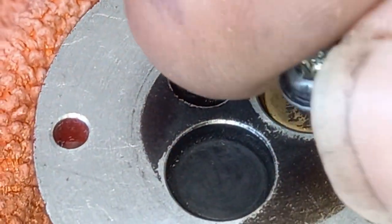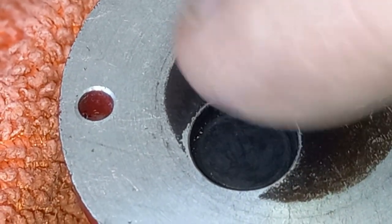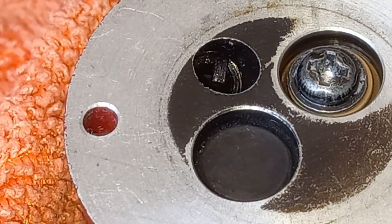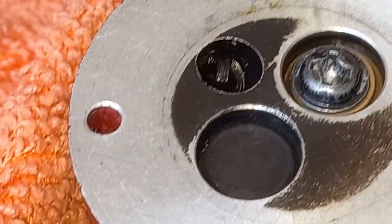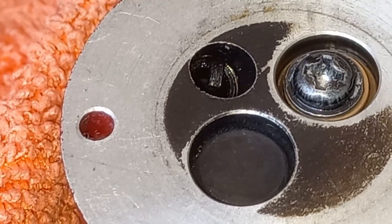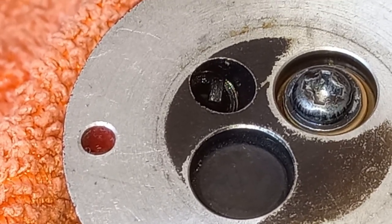So this is going to be super glued on there. We're going to spin that valve and put some pressure on it using that. Then when we're finished we're going to apply a bit of heat onto that and melt the super glue off. That's the process. I'm going to do both valves even though I think the intake valve is so-so.